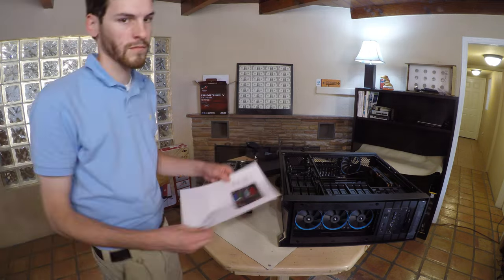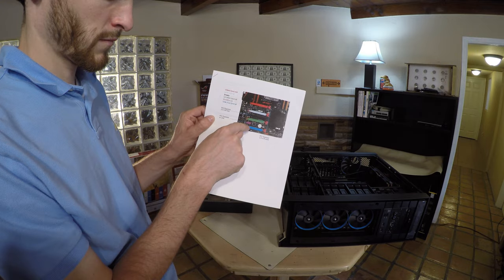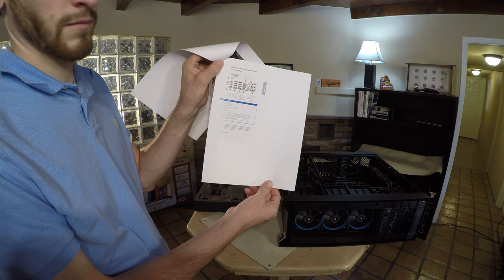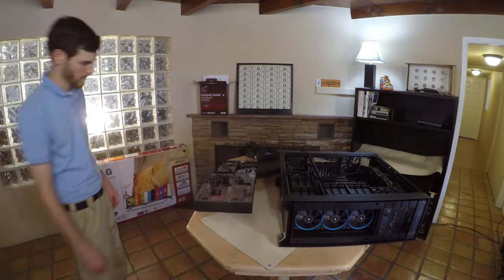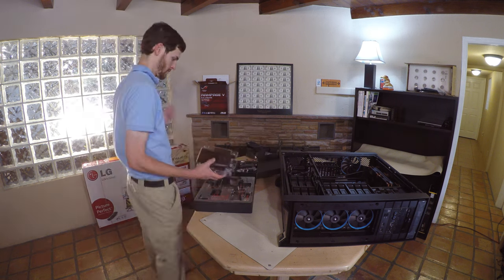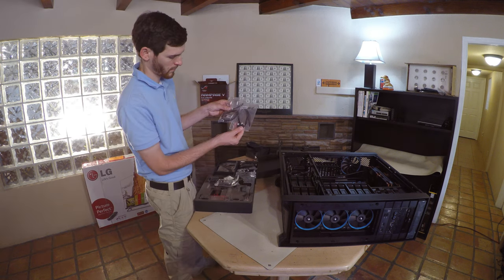This is a USB 3.1 card. Verify that your computer has enough lanes with the processor in order to accommodate all of the PCI Express slots being utilized. Some of the features will be turned off, such as the rear-facing USB ports, when using all of these lanes.